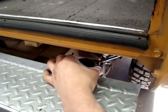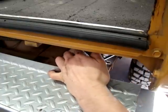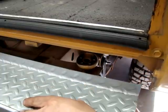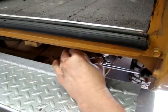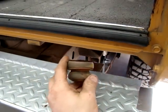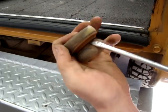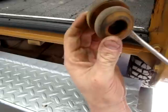What we do is we just reach in here and use a flat blade screwdriver. In the middle of this bushing there's a steel collared sleeve, and what we do is we jam the screwdriver in really tight and get underneath that lip. Once you get underneath that lip, you just pry. By catching that lip — which is right here — we dig our screwdriver underneath it and we're able to pry and catch that, and we just pop the whole bushing out as one piece.